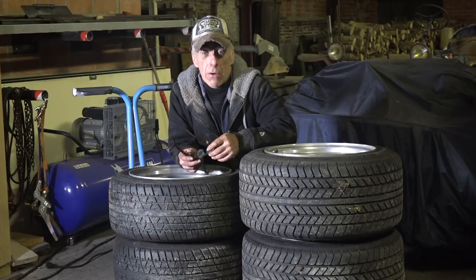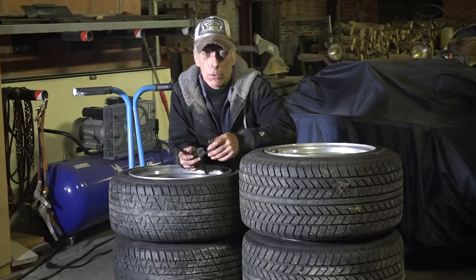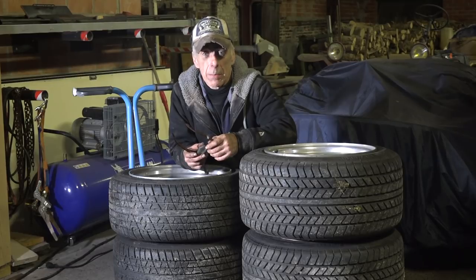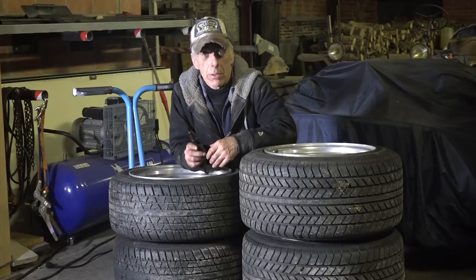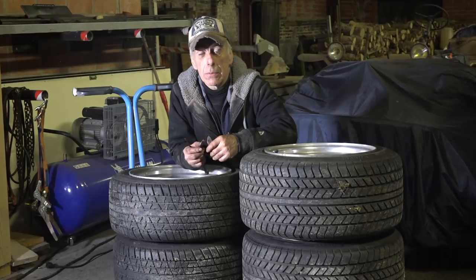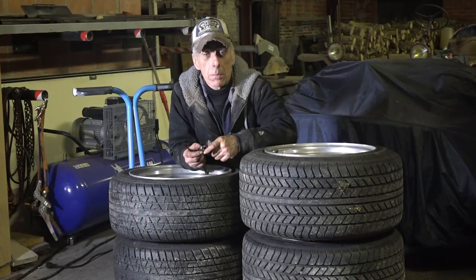In the back we were a bit better off — the brakes looked fairly new or recently renewed, though recently means 10 to 15 years ago. But it hasn't been driven wet so that's the good thing. The drums in the back we sandblasted and they're now looking fairly okay, ready to be mounted again. I will replace the small brake cylinders on the rear axle at each wheel, but that's not worthwhile rebuilding as it's a low-cost item. When all that is done we'll flush the complete braking system, and we'll have to check what the main brake cylinder is doing — but that's something for the next video.